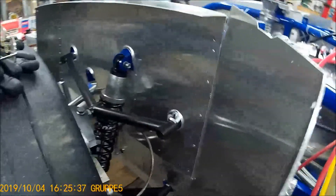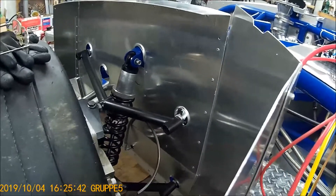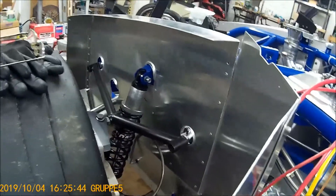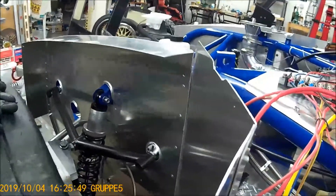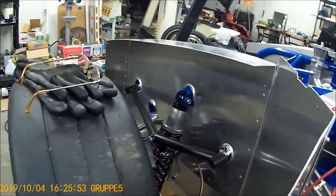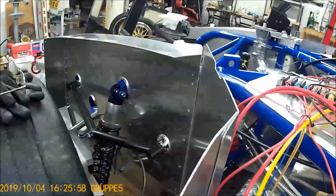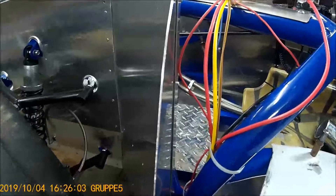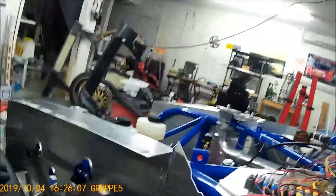On this side I have one of the front — the left front brake line attached — and I just have to check to make sure there's no binding or interference with the coils, and that the wheels move freely from lock to lock without any binding or strain on the brake line. Once I decide that I have a proper length of brake line I will get a duplicate for the right side.